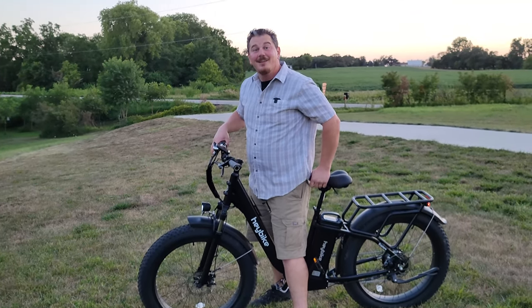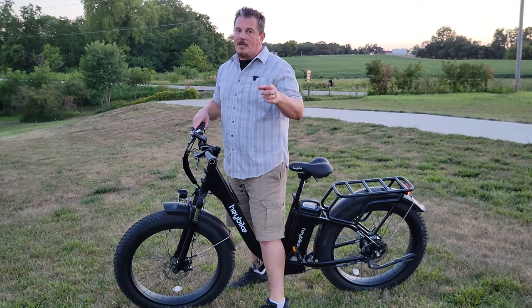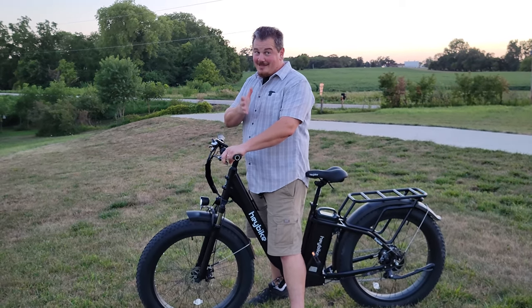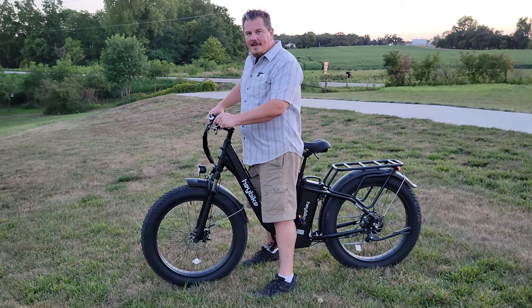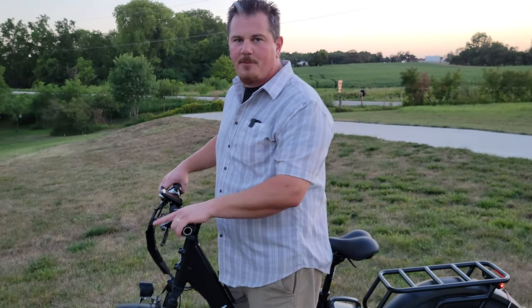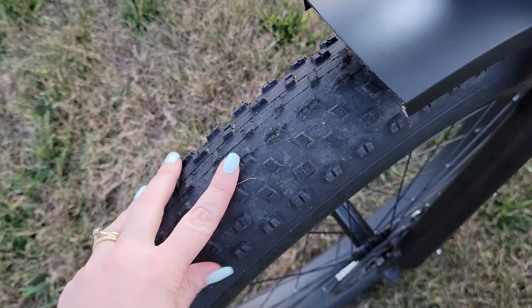I want the drink holder because I use this to hold tools. So I just hope I don't jump off and have an undesirable interaction. That's something to keep in mind if you are standing on the bike. I want to talk about roughness at 18.5 PSI — I feel like that might be a little bit high. The max is 20 on these tires. You could run them lower and have a good experience — you'd be a little better on the off-road side, especially if you're trying to do sand. The traction on these tires is really good, except when you really slam the brakes on a hard flat surface. The good news is this thing will do gravel, grass, mud, and all the stuff we're going to run into.